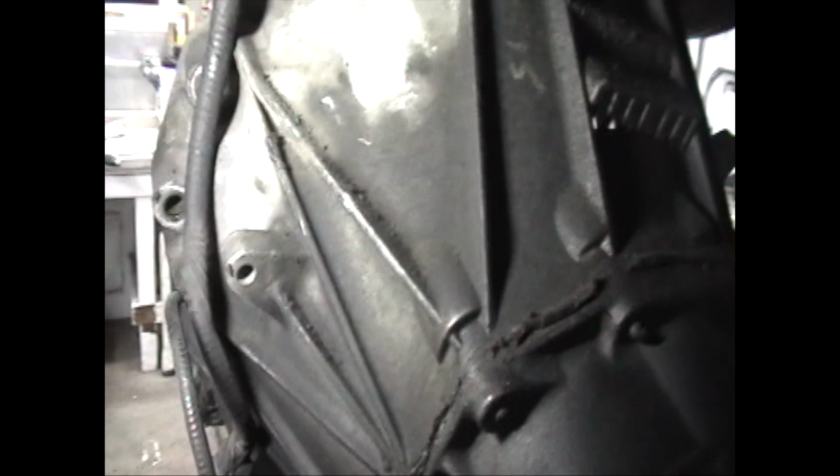And these, one on each side, were hitting the body, you know, inside the tub. So I think going together, I'll just take a hacksaw and hacksaw that one off, and hacksaw that one off, because they were hitting pretty good. Let's see if somebody else has been up in there on the marks. If it was mine, I'd trim it. So if I ever have to do it again, it'll help me out.